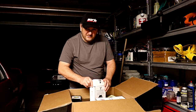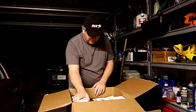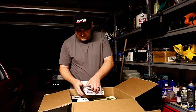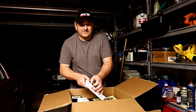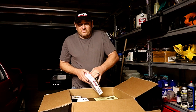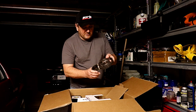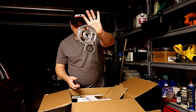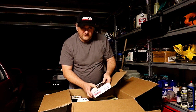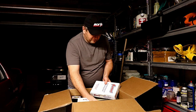I'm a little worried about hooking up the fuel pressure regulator though - I've never done a remote one like this. It's just going to involve fittings and I'll have to retrofit the fuel lines in the car to fit that. Once I get the intake manifold off I can figure it out. I also got one brand new double roller timing chain - since you're into the engine, it's better to be safe than sorry.